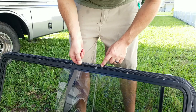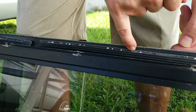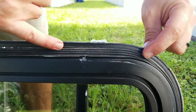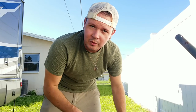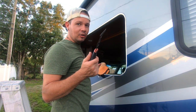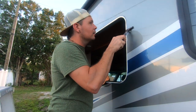This is what we're going to replace using butyl tape — automotive gasketry for windshields. If you look here, you can see little bits of paint evidence where it was actually contacting the side of the RV. Then, from right here where it pinches, it turns into clean gasket — like it's never been squished — and that's a giant gap that's actually a factory defect. Somebody rounded that corner too high. Luckily Shane came to the rescue with a proper metal scraper. Don't ever bother with plastic scrapers — they're garbage, even if you're using full body paint. I tried a razor blade with awful results. Just get a metal scraper and be done with it.